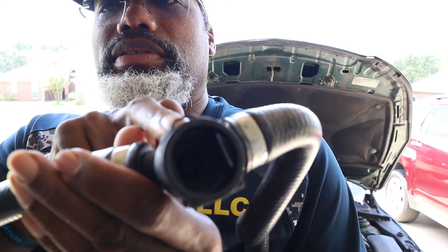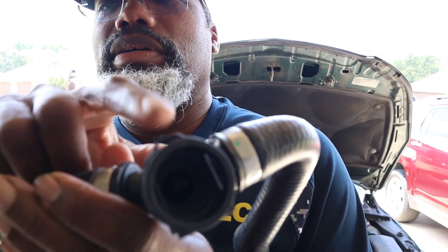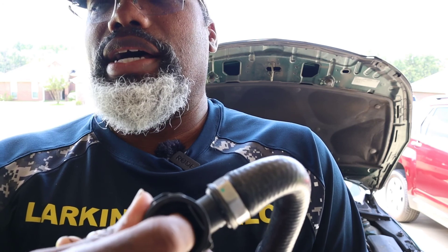And the way it works is here — you take your pocket screwdriver, flat tip or whatever, and you just pick up on here. She'll pop off. The O-ring is inside; I already checked it. Gonna lube it up and grease it, and pop this thing off. We try to lose minimum antifreeze doing it. It is what it is. I'm finna get it done and move on with troubleshooting.